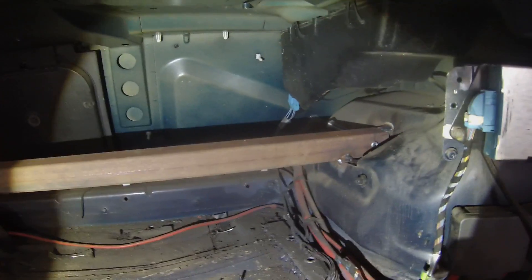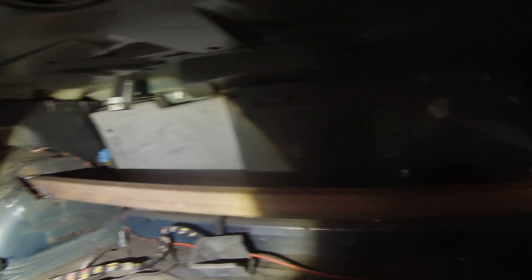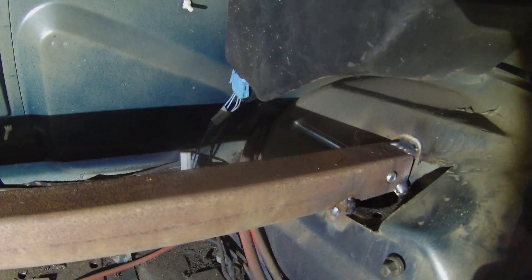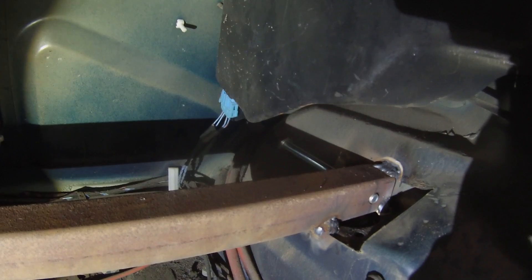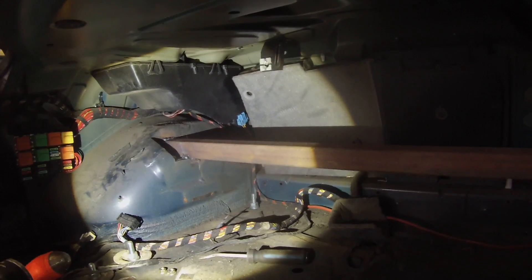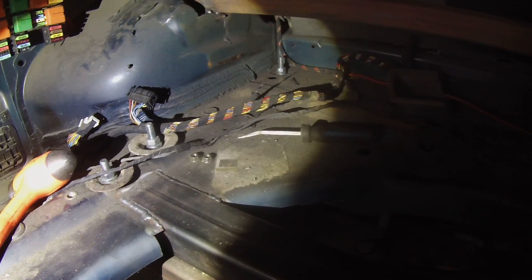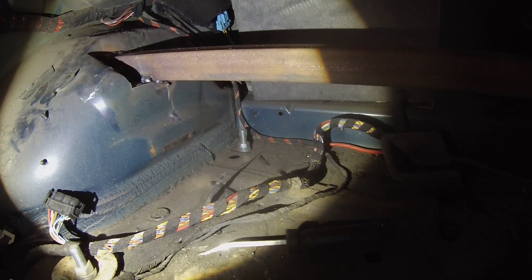In the back here, we've been working on our strut mount. You'll see we've got a piece of 40 by 40 box section steel spanning the back of the car, and our struts mount through it. The head of the strut comes up into the box section, and a bolt then goes in through that. This is how we're mounting our struts — it's currently welded to the body of the car.